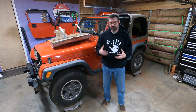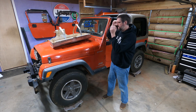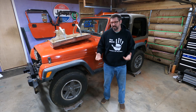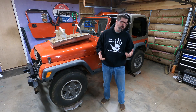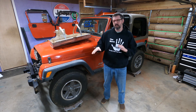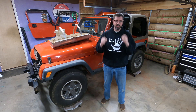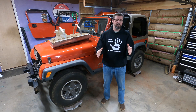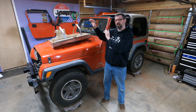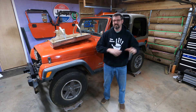I knew the arm wasn't positioned correctly because I retrofitted a diesel lift pump into my stock TJ Wrangler fuel tank. Today I'm fixing that. I also bought this aluminum skid plate for the stock TJ Wrangler fuel tank — the best part is it actually lifts the fuel tank by about two inches, so I'm going to get two additional inches of ground clearance at the rear of my Wrangler, giving me a much better departure angle when climbing obstacles. Huge shoutout to John, who sold it to me on Facebook — he saved me about an hour of driving and really worked with me to get it to me.